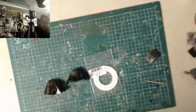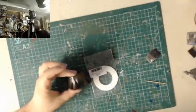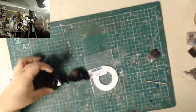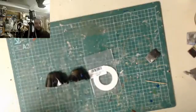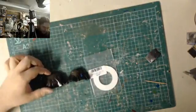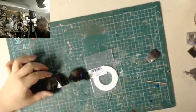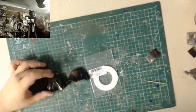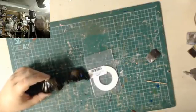So what we're going to do is we've got this surface. It's painted in lacquers, and we put a clear coat over it. We're going to apply the mask, put paint, mask again, paint again. If we do leave it on there for a few days or whatnot, if it does get really well stuck and lifts any paint or any residue, because we have a fully cured clear coat, it'll affect the clear coat, and that can be buffed clear coat and whatnot, and it won't actually affect the paint itself.